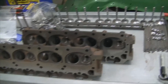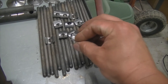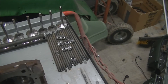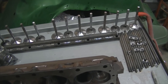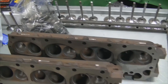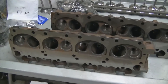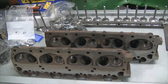So I did order from Mancini Racing the rocker shims — I ordered their assortment. I got 10 of each: 030s, 010s, and 015s for shims. So I will put this together and shim up the rocker shaft assemblies as needed. They're going to be pretty close — I'm going to use the 030s just to give me some extra room. I don't think I'll need more than that. But we will clean these heads and assemble the valves and get the springs in.